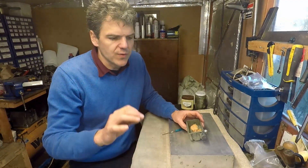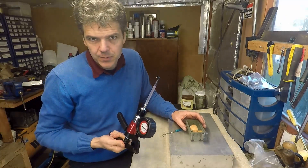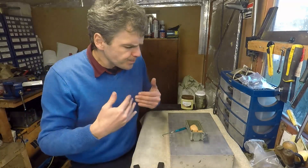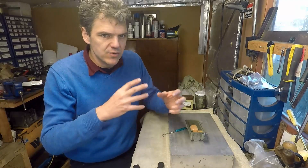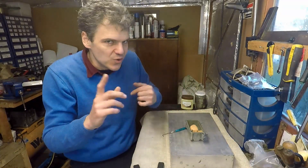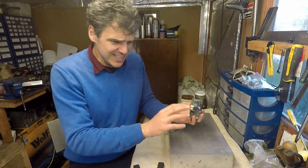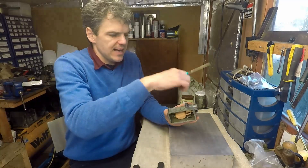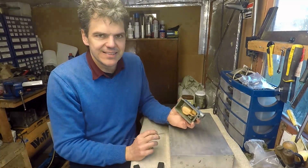This actually brings me to the point I want to make in this video: the importance of testing everything before it goes on the car. In my case I was using a vacuum pump, but you can use other methods. I find vacuum pumps work really well because they give you an indication of whether things are okay or not, and then you need to do some detective work to identify specifically what the problem is. If you install this in the car and it starts leaking, you might think the problem is the needle and seat assembly, change it, and get the same thing.